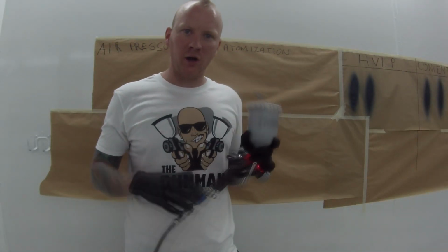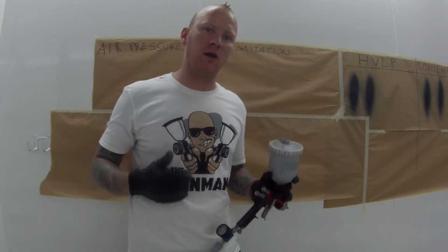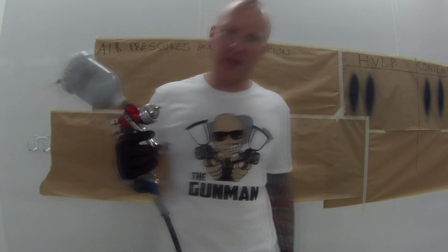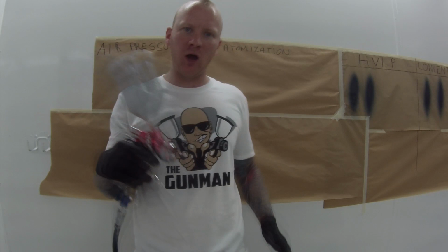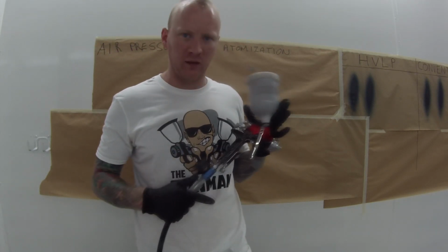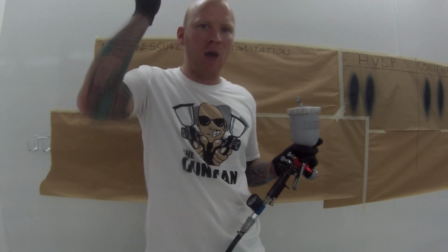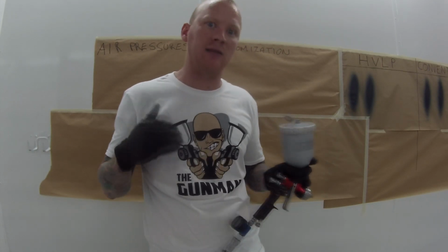In this video, I'm going to teach you guys about different pressures and how that's going to affect the atomization. I'm leaving just the one air cap on here. This is the H1, which is the HVLP air cap for the DeVilbiss GTI Pro. I'm going to go right down with the air pressure, and then right up, and I'll get you guys up close to the camera to give you a look at the way that it actually atomizes.